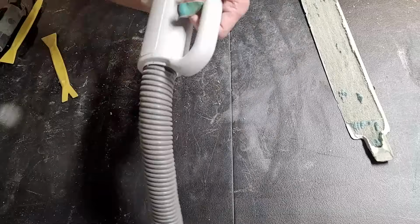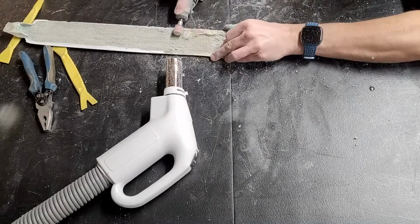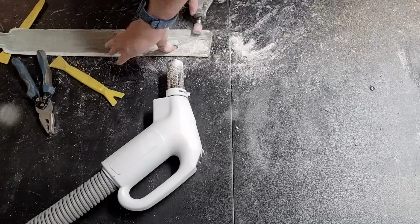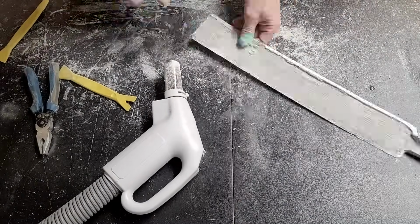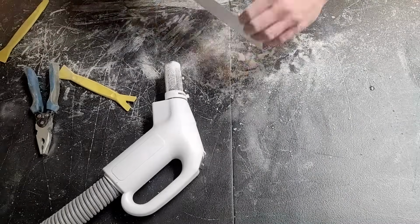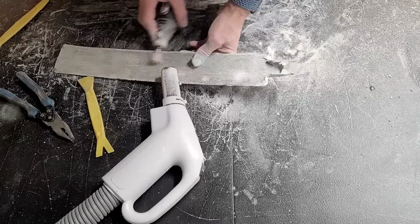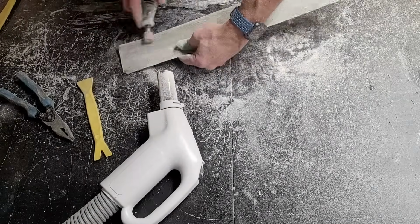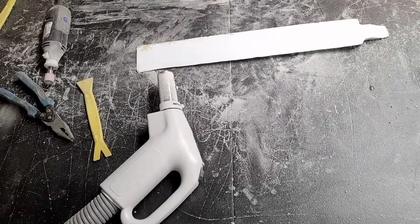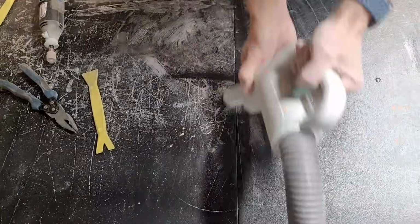And then some of that has actually got epoxy in it. You can see what's remaining there. So I have to grind away the epoxy, and the epoxy that did soak into the foam has left a weird kind of surface on the back there, so I've got to grind that all smooth. I've got to get the cover itself a consistent thickness across, a little bit of paint on there as well that needs to come off. So I basically want to have this fresh cover so that I can just mount it onto the new strut as it needs to be, and that will be good to go. I am actually scuffing the paint because I'm going to repaint that cover as well.